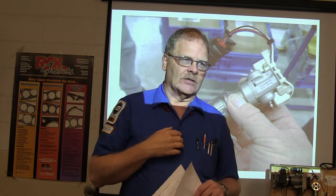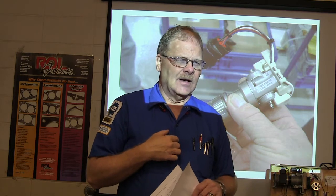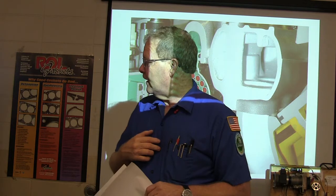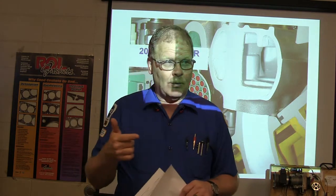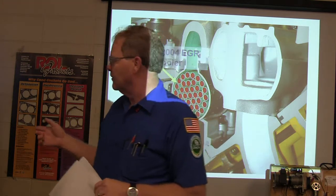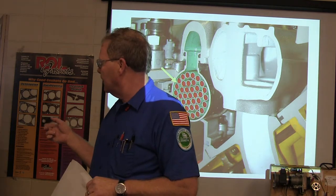So if it's over 6 years old, you need to start looking at it. My wife had to have tires put on her Explorer because it's only got 23,000 miles on it. And anyway, the point is, because they were dry rotted, they looked like good tires when we put them on there, but they were too old.